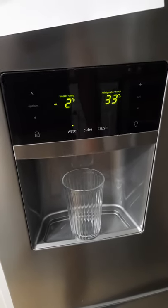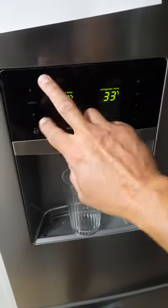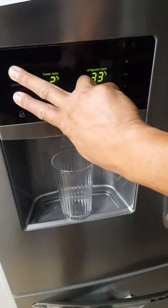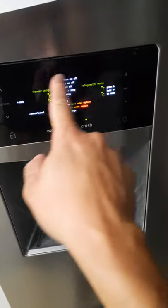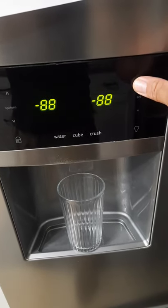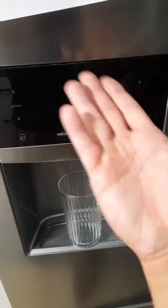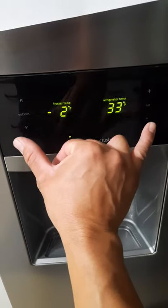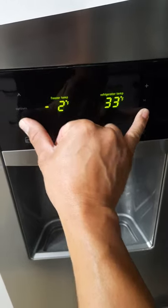The way I do that is I start the self-manual diagnostic, which is pressing up and down together. So you press these together — that's the menu that will pop up. Then press plus for a few seconds, and it resets. Now when you press down and minus together, it does that.